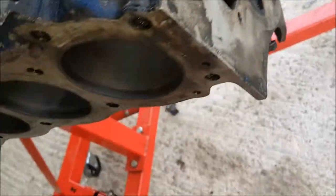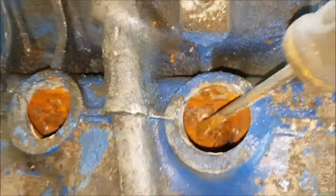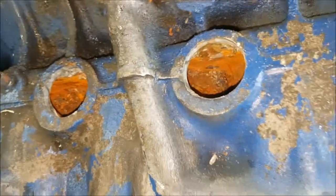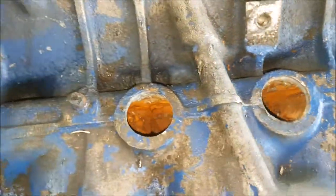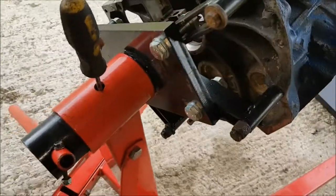This is the cooling system and it's got a lot of crap in it. Fortunately it's all quite soft crap, so I think it'll wash out if I put the hose pipe in. The cooling system goes in through that hole there and runs around the inside of the block - it doesn't go down into the crankcase, only around the top end where the cylinders are. There's no need to run any lower than that. This is the sort of stuff that plugs up the radiator and the heater. This is the reason why you need to pull core plugs out on an engine where you just do not know the history. What I'm going to do next is drop this down to the deck, lift off the frame, and get the two core plugs out the back.